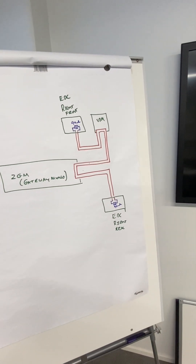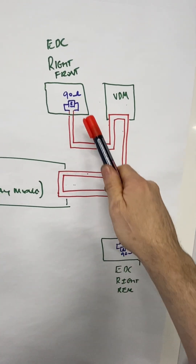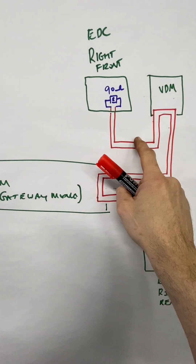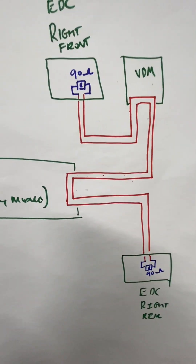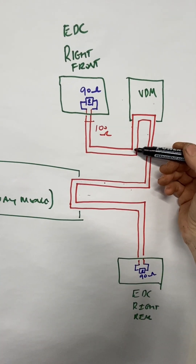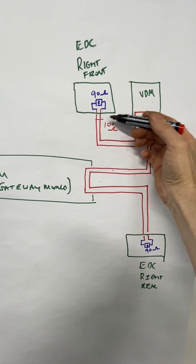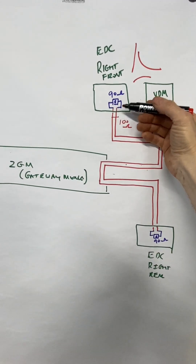Here's an extremely rudimentary diagram — I'm not an artist and I'm a terrible writer too. That's the right front suspension, that's the right rear. We now have coil overs, not the original dampers. The VDM couldn't communicate because when they took the suspension leg out, they took the 90 ohm resistor away. So I added my own 100 ohm resistor across the bare wires, and that's why we then had comms with the VDM. FlexRay goes into the gateway module as a loop — it's just the two suspension legs connected to the VDM and the gateway module. Without the resistor, you get those horrible signal reflections, like the weird ones in the scope trace.